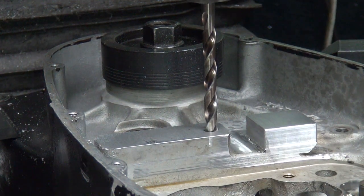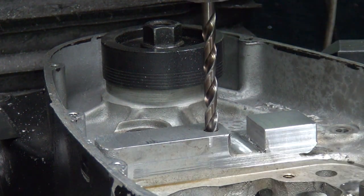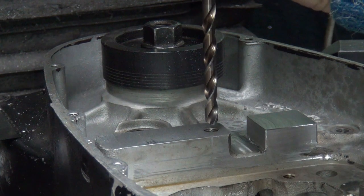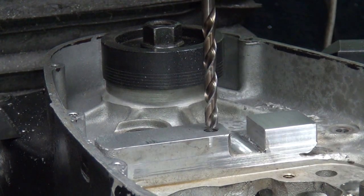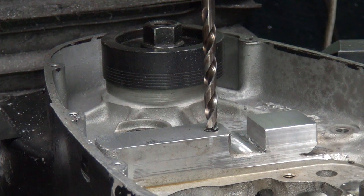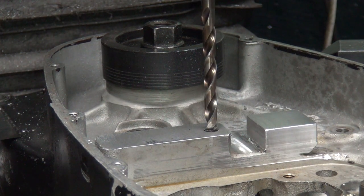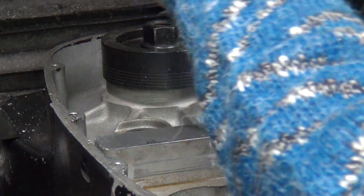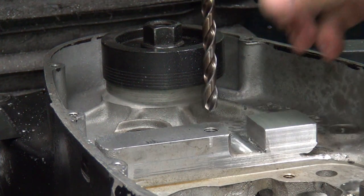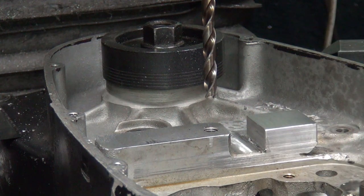Turn the drill 180, check it again. Goes a little easier, so a few more thou. Move back, check it 90 degrees this way. We're way off. Too much. Looks good. You can also hear the little ding ding ding as it hits the edge. More ding ding noises. Ding ding is when you're hitting against a drill. So now you can turn this, doesn't do any damage to the hole. You're on center. So we got our center dimension now.